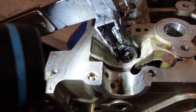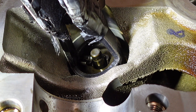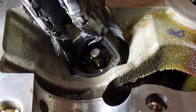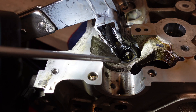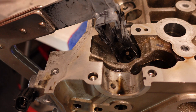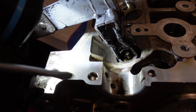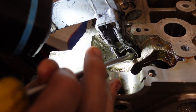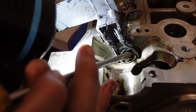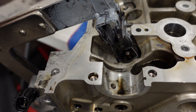There's a little ridge on top of that valve and that's what those little wedges stick in against. Using a magnetic screwdriver now - and it comes out like so. There's another one down there but it's pinched against the retainer and the valve, so we just move the compressor tool to give a bit of clearance so we can then remove it. Put that to one side as well.